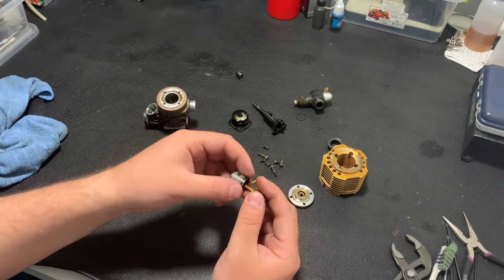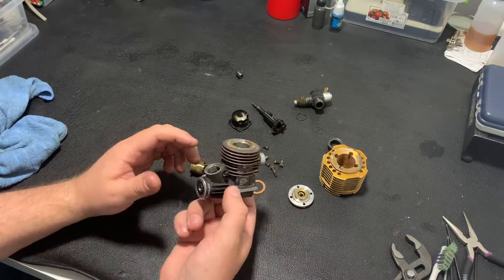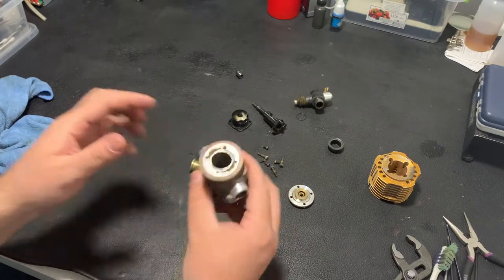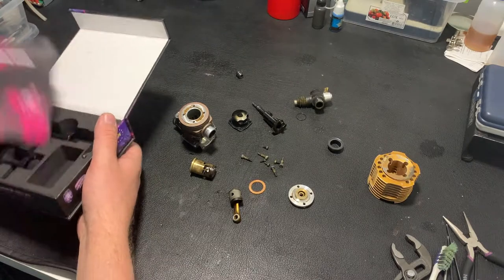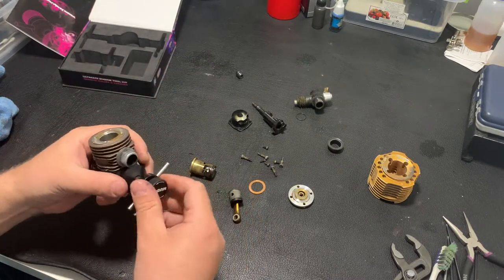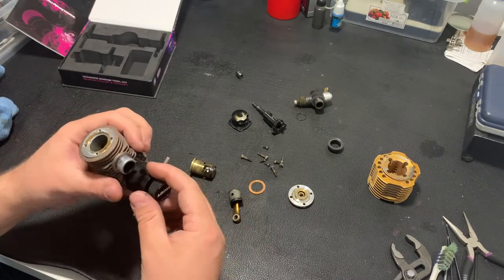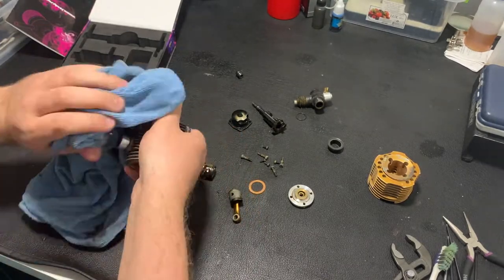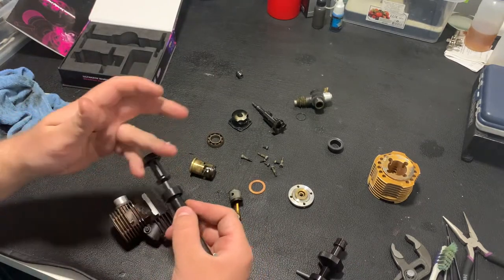Of course, I will clean everything. I will remove black dust from the piston. I will remove the bearings now to clean them. They are not very bad, but need to be cleaned. To remove bearings, I have just another tool. Special tool for bearings. So how I'm using it. At first I'm removing the inner bearing. And the front bearing.